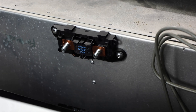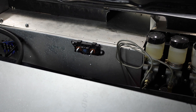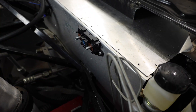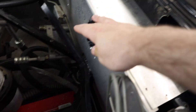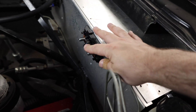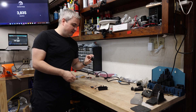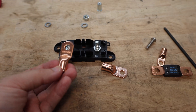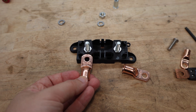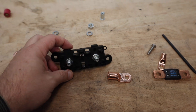We are mounted to the chassis — mounted directly to the chassis and not just the firewall itself, so there is structure behind it. Next comes running a wire from the kill switch up here through to this side, and then we're going to run a wire from here to the battery. With all the parts here we're going to put this together, but we're going to have to make some modifications to the fuse block itself. These odd connectors won't fit in place, so I'm going to have to take some material off on either side so they can pass in. We're going to do that before we start wiring it up.